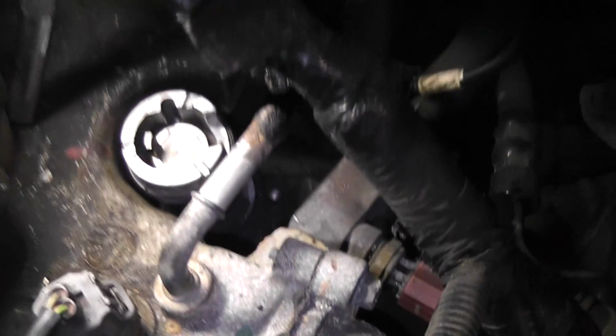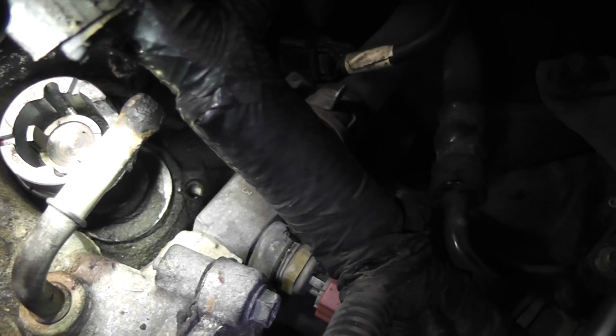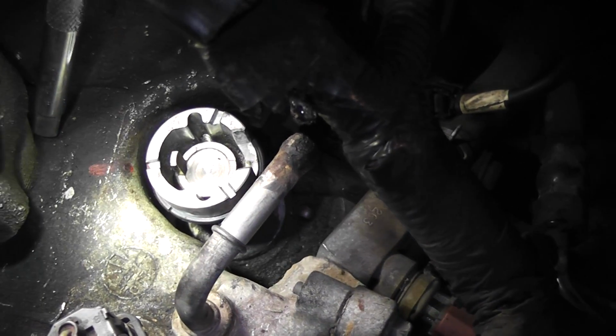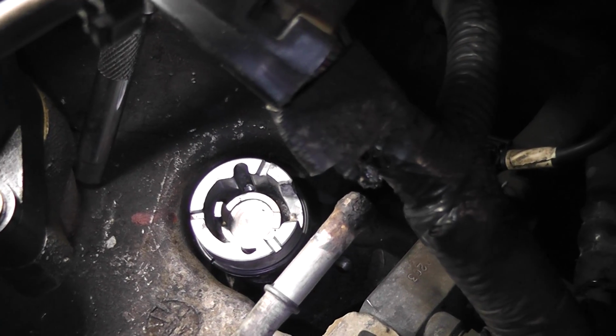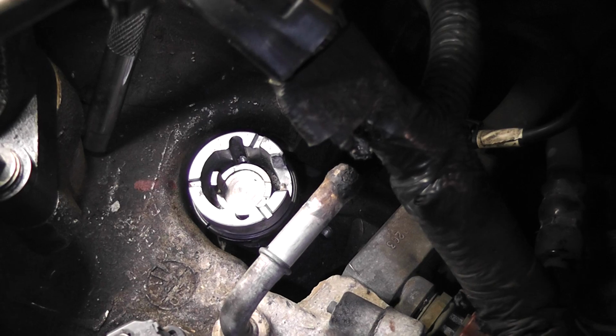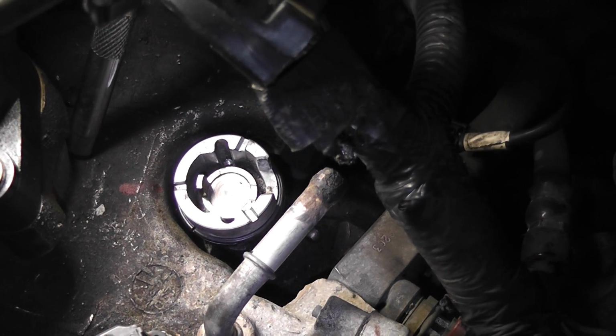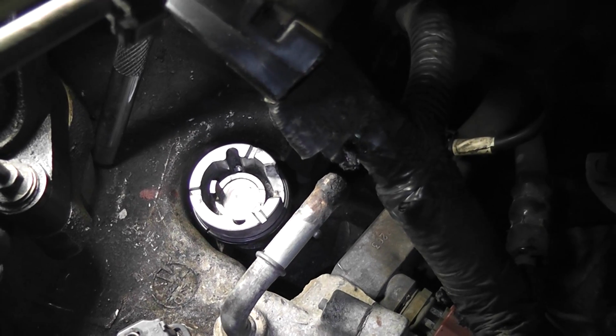So, if you see the hold-on bolt right there, I'm pointing about where Mitchell was saying to put it. Either way, like I said, if I put it in there, it would work, but I'm going to use the tool. I'm going to turn it over until the tool fits, slide the old one out, put the new one back in, then we'll see where we're at.